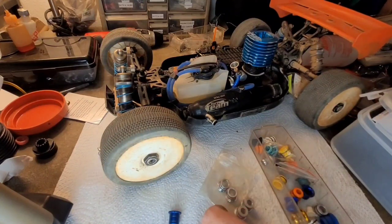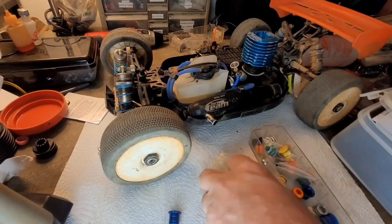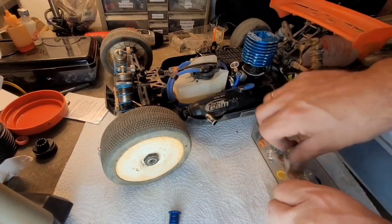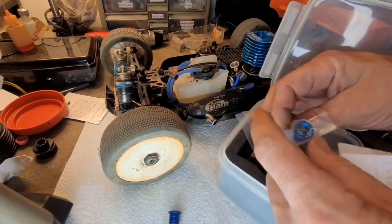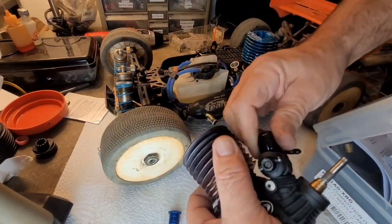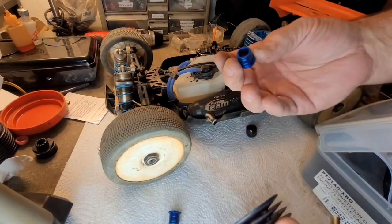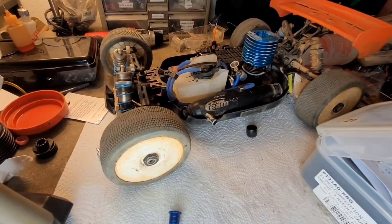Those look the same. It's a 6.5. So, no, all right, I had to grab the 7 out of the SH. Give me one sec. Of course, that's the one that's in it. I got all these 7.5, 6.0, 6.5. Yeah, the 7 comes in it. So that's the one I ran in it when it came stock. 7.0. So yeah, I'm going to run the same size Venturi as I ran in the 21AO, so I can gauge the difference between the two.